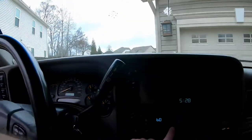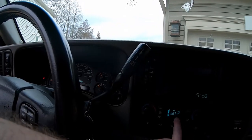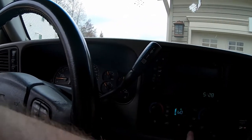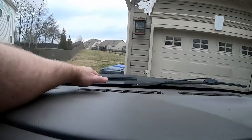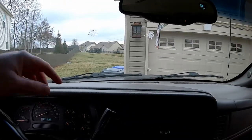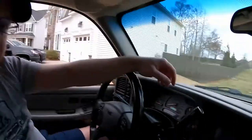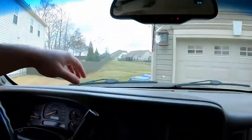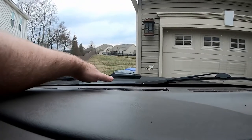So if you're in the truck and you turn on the air, you change the modes - we're trying to get air conditioning, so AC is set. There is nothing coming out of the vents; that's kind of the first problem. It is however coming out up here, so I'm not sure if the vent up there is related to the hot air coming out. The second problem is the temperature - we have it set to 60, but it's probably blowing 75 to 80 degrees. So the AC is hot and it's coming out of the wrong vents.